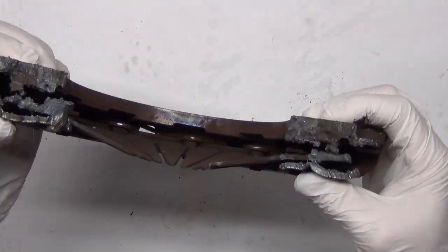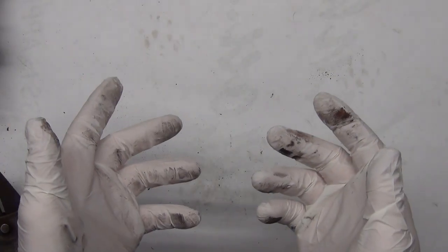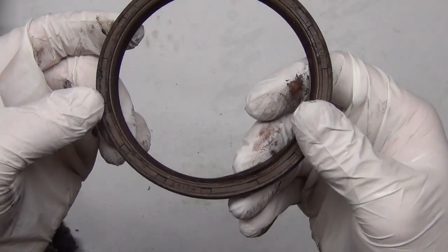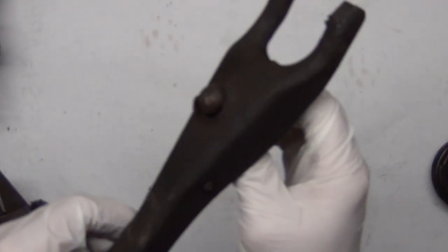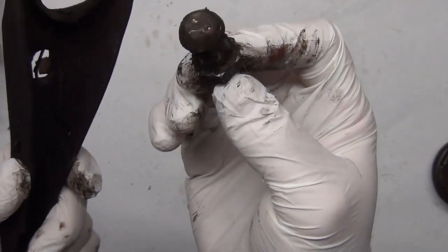I do have the cutaway still kicking around — I cut it open. I'm going to show you all the things that can fail in a clutch and things that you should address. One of which is a rear main seal — while you have the flywheel off, it's a good idea to replace it. The way to tell a bad one is they just get stiff, and once they're stiff they don't seal as well. The bearing is really dry — you can hear the balls just rattling in there. The clutch fork failed, everything failed on this at the same time. The fulcrum also has a lot of wear on it.